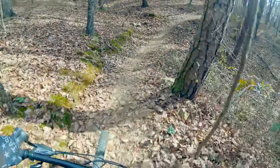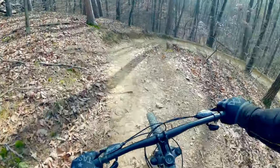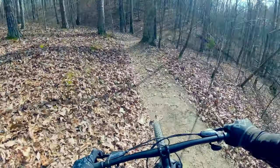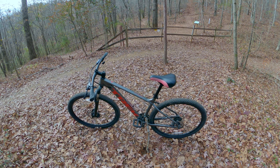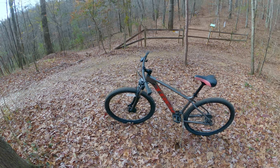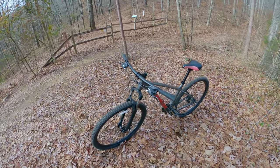The bike I got for my wife is a medium-large. I'm 5'11" and she's about 5'6"–5'7", so it feels a little small to me since I'm used to a bigger bike, but it fits her great. One thing I really liked about the Trek Marlin over the GT Aggressor is the 29-inch wheels. I really like 29ers for beginners getting into trail riding — they handle roots much more easily, rollover ability is better, and each pedal stroke gives a little more with the larger wheels, making climbs easier.